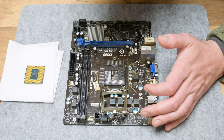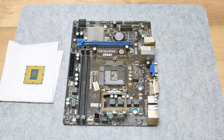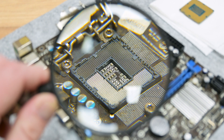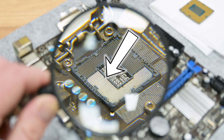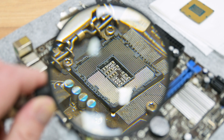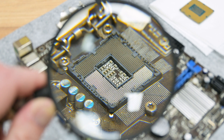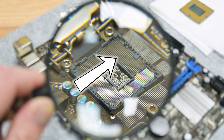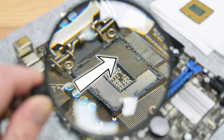The reason why this motherboard is not working is that a few pins from the CPU socket are damaged. Let's take a closer look at the socket. This pin here is more curved, even a little bit damaged, because the pin was pushed between the CPU and the plastic on the socket. The pin next to it is a little bit curved, but not that much. And here at this point one more pin is damaged, but from the current camera angle it's not noticeable.